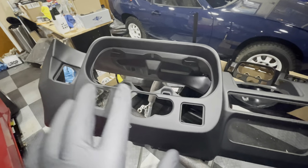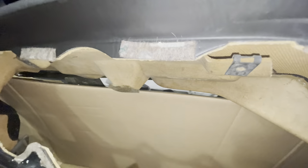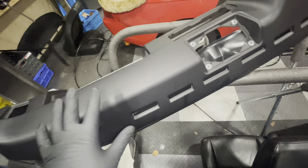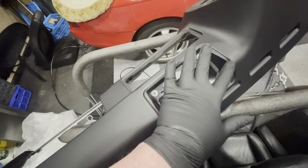Let me take you through the differences between this dashboard and the one from the 80s. This new one is made of ABS plastic — if we look at the old one you can see it was all cardboard, which is also the reason for dashboard cracking, because you have different expansion rates for the top layer versus the bottom layer. This being one piece of plastic should not crack again. I need to transfer all the hardware from the old dashboard: the grommets, brackets, speed nuts, and a whole bunch of other stuff. I also need to install the three vents. Once all of that's done, we're ready to bring the dashboard back into the car.